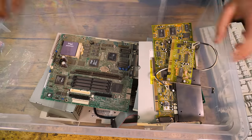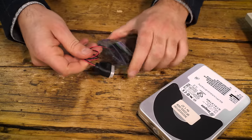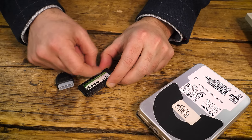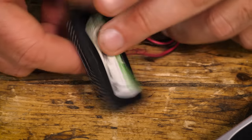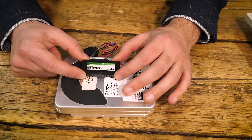So that's the keyboard, the mouse, RAM, the CPU, and the remote control. For storage, we'll test the original 1.2 gigabyte Seagate drive in the hope that we can image it to make setup easier. And I'm going to replace that spinning drive with an industrial DOM — disk on module. This is a flash memory device that sits neatly in the IDE connector on the system board and replaces that spinning drive, hopefully with zero compatibility problems. It has a four gigabyte capacity — less than a single layer DVD, but a luxury by 1996 standards. I bought it used on eBay, fingers crossed we won't have any problems.